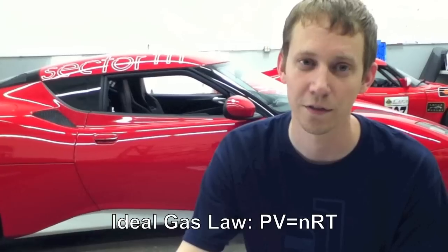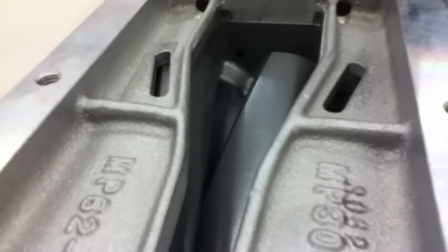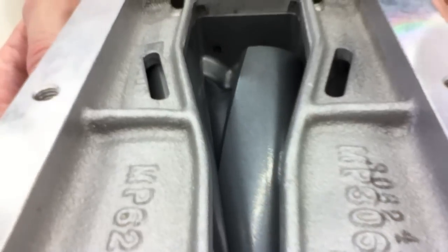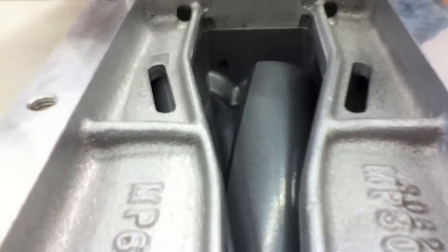Unfortunately, you can't build pressure without heat because of the laws of physics. This pressure build-up and heat build-up are also the limits of the supercharger. If you look down into the supercharger in the valley here, you'll see along the edge of the rotor blades there's a sealing surface where the rotors mesh with each other, forming a trapped volume of air that's attempting to be as solidly sealed as possible. But once you get up to around 14–15 psi in this blower's case, it can't keep all of that air volume sealed once it's exposed to the pressure in the intake manifold. You get some leakage back out and around the rotors, around the edge of the case and in between them. So some of the air is going into the intake manifold, but some of it actually comes back into the induction side of the supercharger as well. That, tied to air flow based factors and flow numbers, is what limits these superchargers.